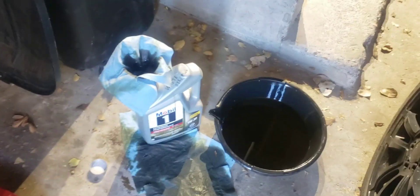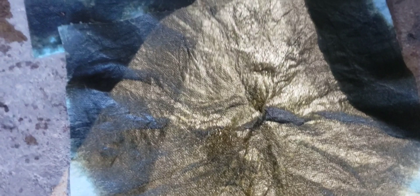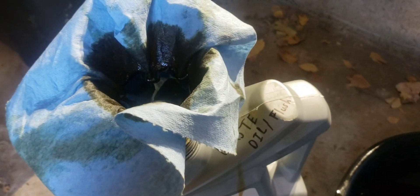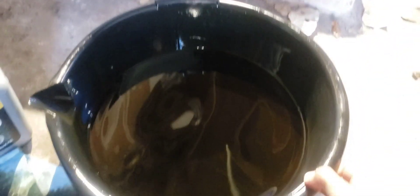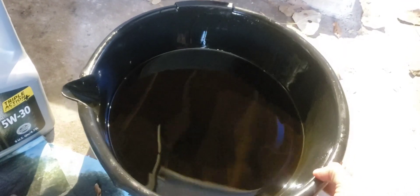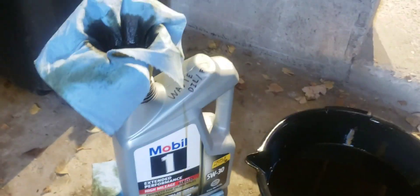I discovered this is going to take a long time to filter, but here's my first filter paper towel. You can see there's not really any sparklies in there — just a little moisture-looking stuff and it's real dark. This second rag is one of the filter rags and I still have about half a quart or less left to filter through to check for any heavy material.